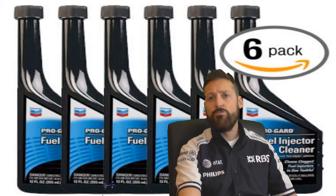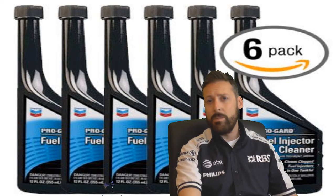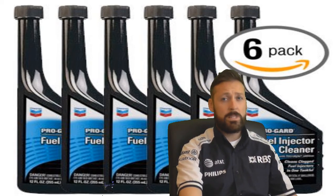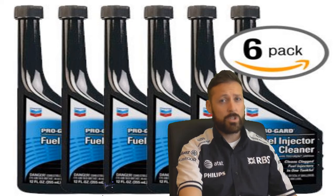Alright, so let's say you've tried all of this and your car still fails the emissions test. You can try fuel injection cleaner, pour it into the gas tank, and then drive your car really hard at about 70 miles an hour for about half an hour to 45 minutes. You'd be surprised about how often this works.